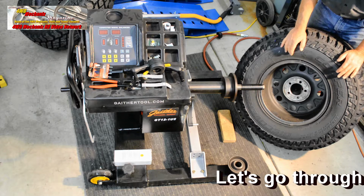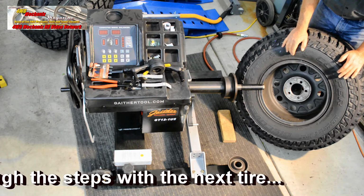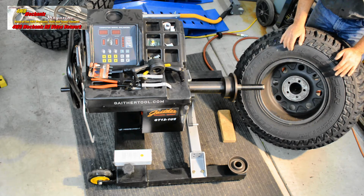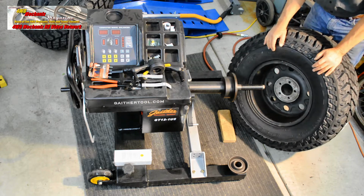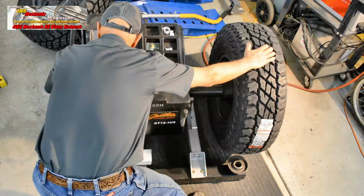The inside of each of these wheels has been cleaned thoroughly with white gas or Coleman stove oil. And as you can see, there's no adhesive, grease, or anything else that'll prevent new weights from sticking to the wheels. Put a block of wood under this time to bring us up to the center line.